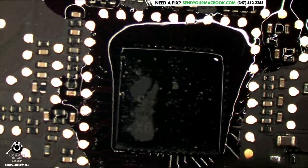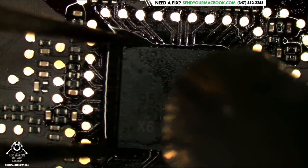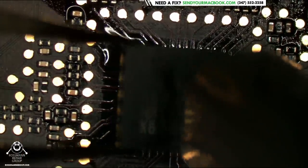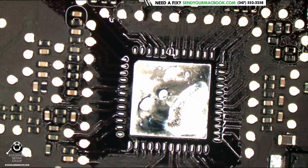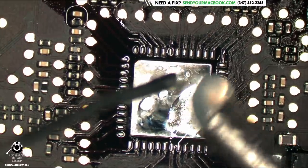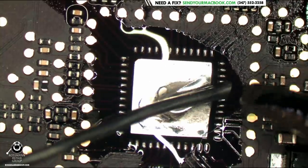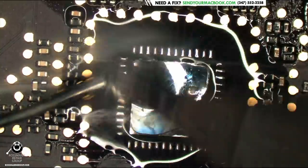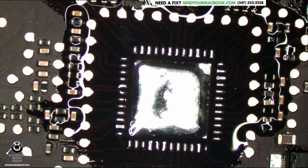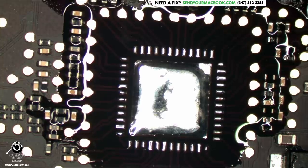As Paul S., one of the chief technicians here, has told me: 80 to 90% of the time that you have corrosion on that MOSFET, your CPU is dead and there's no point in continuing. Yet almost every time, both him and I still have this ridiculous, blind hope that this is going to be the time it's different, even though everything else is the same.